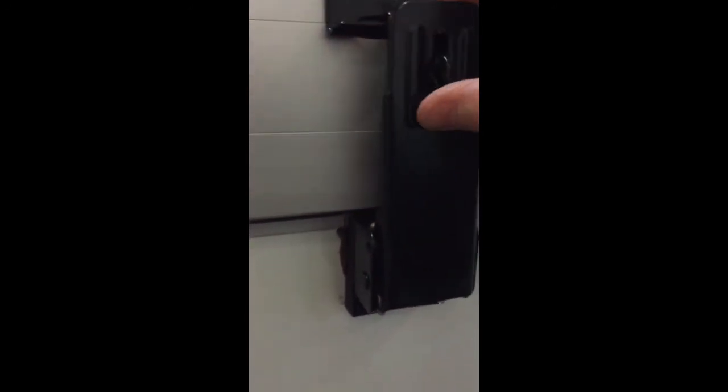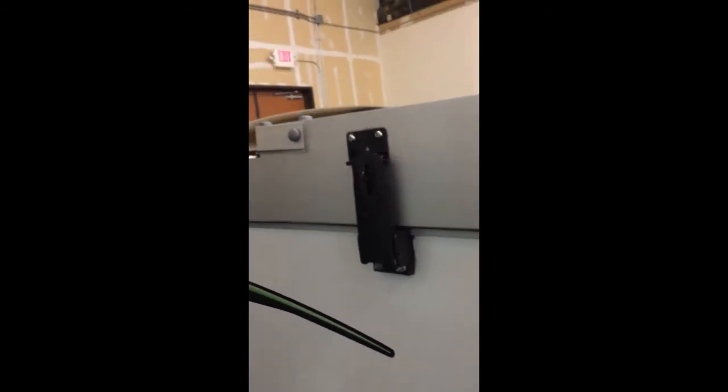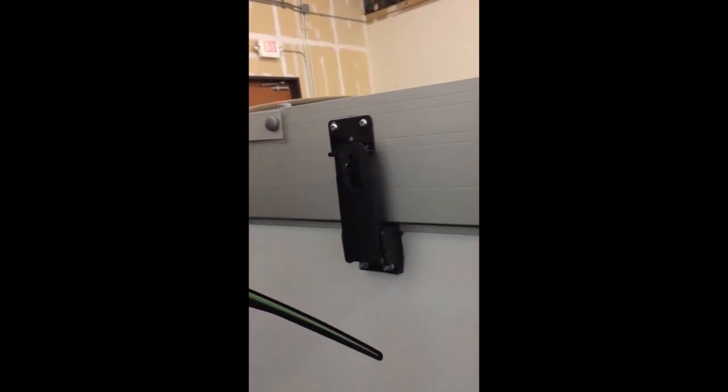That's definitely going to be one of the main things you want to keep an eye on, all your seals. You want to check them at least three or four times throughout the year. Did you guys check all that before we're taking it home today to make sure everything is sealed? If you see any holes or cracks in the sealant, that's when you'll want to replace it. The worst thing for campers is water. Yep. Once that water starts getting in there, it really gets in.